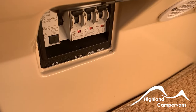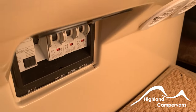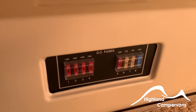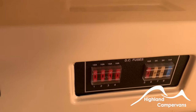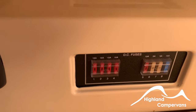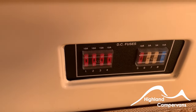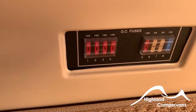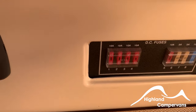Just below the couch on the left-hand side of the vehicle you find your RCD fuses — these protect the 240-volt circuits inside the vehicle. Next to that are the 12-volt fuses: these are little blade fuses available from most car accessory shops, in different sizes from 5, 10, 15, and 25 amps. It's always useful to carry some spares, and the manual that comes with the vehicle will tell you what fuse protects what item.